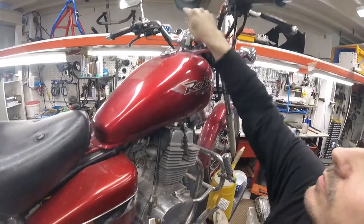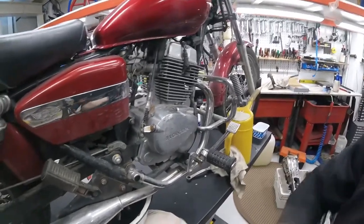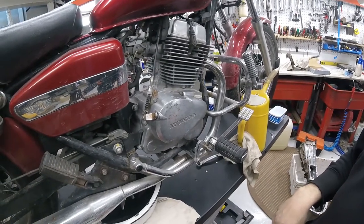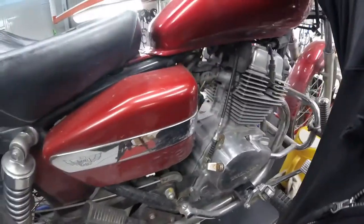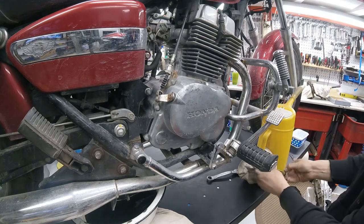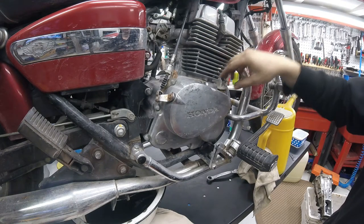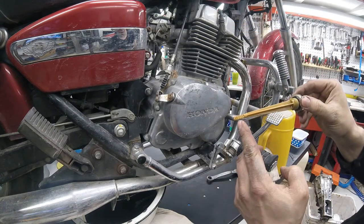Okay, let's start the engine. Just for a while. Okay, I think it's good. Now let it set for a few seconds. Take the dipstick up, wipe off the oil, and check the oil level. Now just let it settle there, don't screw it all the way in. So it's just at the minimum.